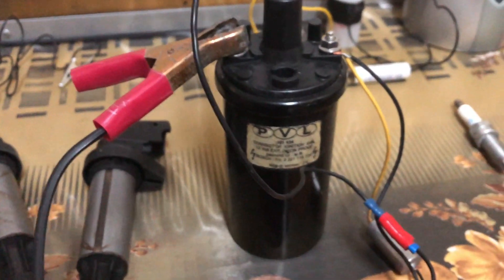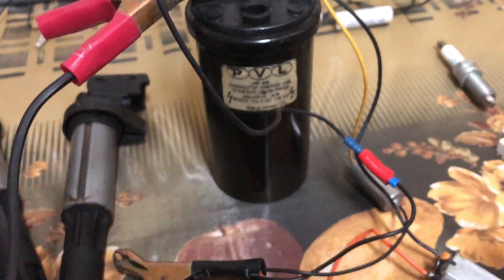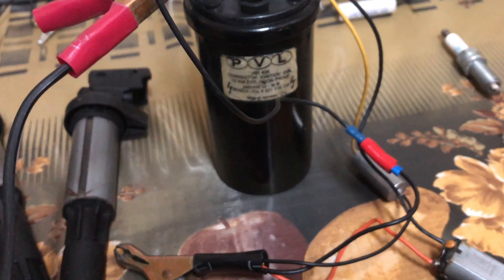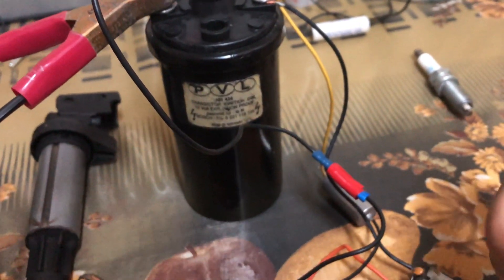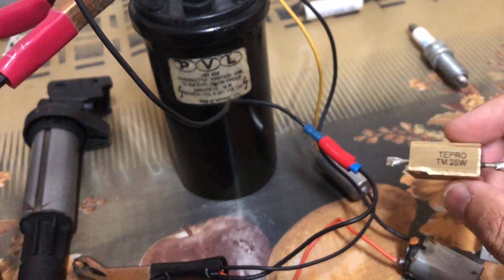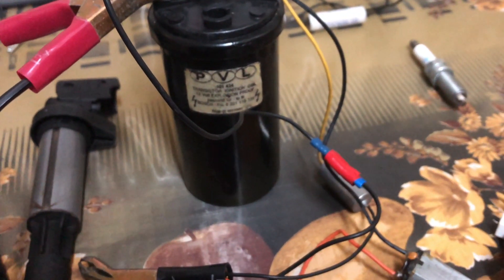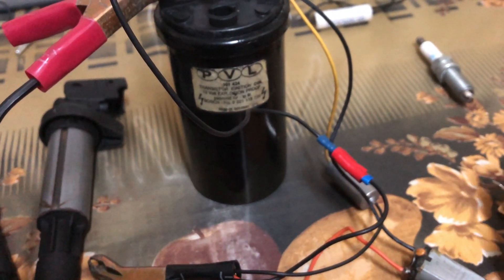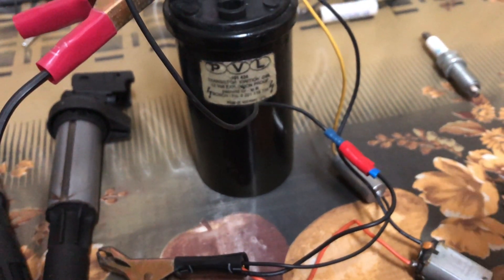You may have noticed I have not used a ballast resistor, but since we are running it through the motor this is okay. I don't have a 1-ohm resistor with me — the smallest I have are higher values. If you have a 1-ohm resistor at around 5 to 10 watts you can put that in series with the motor.